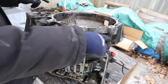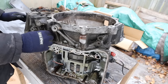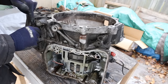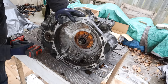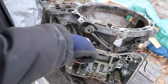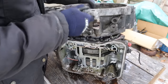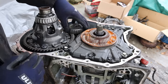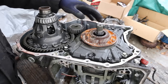Next I need to remove all the bolts that go around to take this top half of the bell housing off. I hate it when Volkswagen does something like this — it means you're going to have to get in here with a wrench or a ratchet because you can't get in there with a gun. Why couldn't they design this a little better? Here's a look inside of the 09G. You can see we've got our standard open differential, there's a countershaft over here, and on the input side here we do have the oil pump.